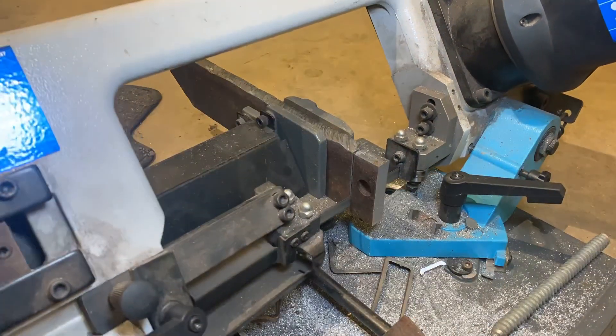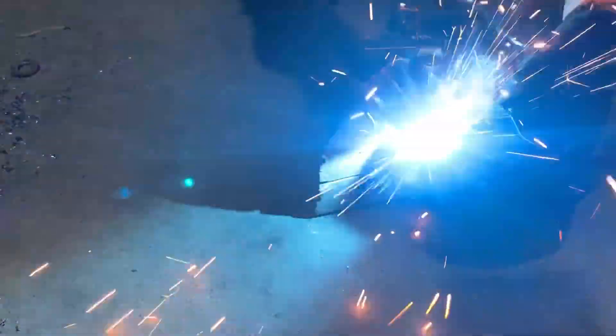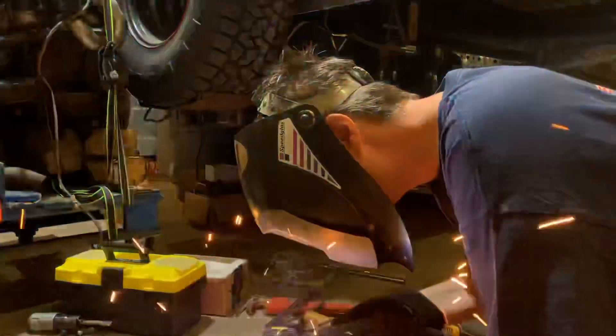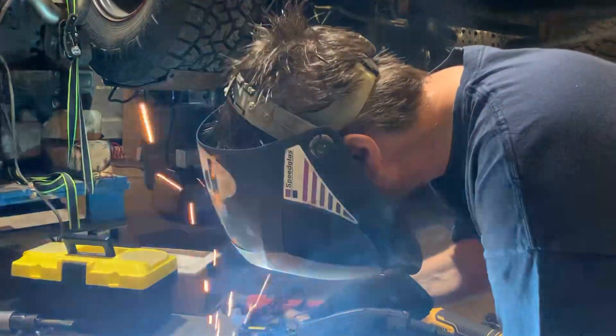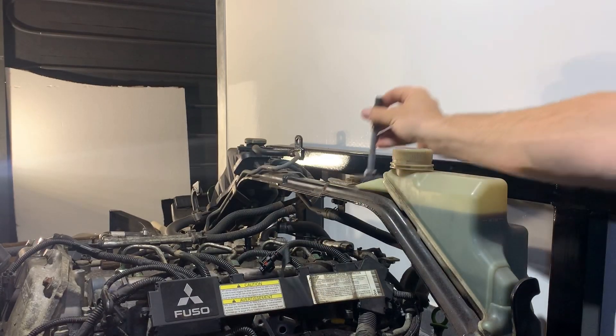This time I'm going heavy duty. And after a little bit of cutting, grinding, and welding, here's injector number four puller adapter version 2.0. So what's the difference? Well, this one bolts together tight, which means the vibration can't be absorbed in a loose connection, which means every ounce of energy that comes in here, other than the losses through the 90 degree transfer, should be transferred directly to the top of the injector. With a rigid extension, I should be able to get the injector puller tool almost directly above the injector. So what do you say? Let's give it a try.